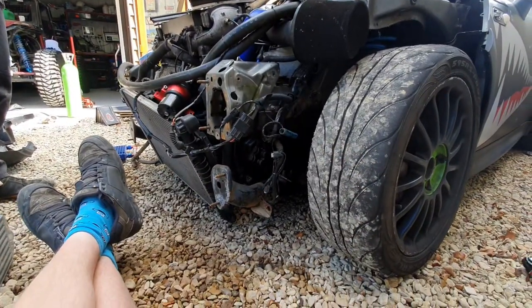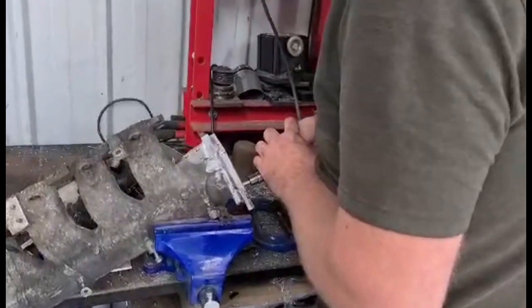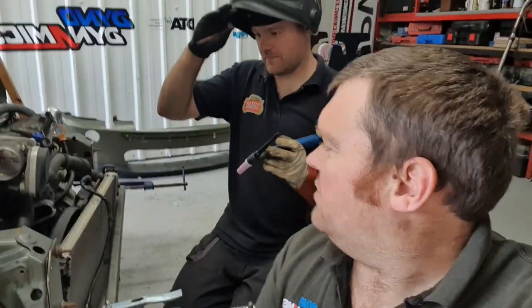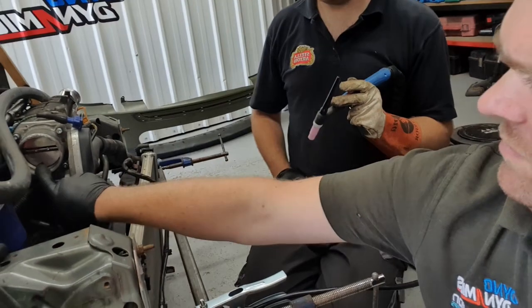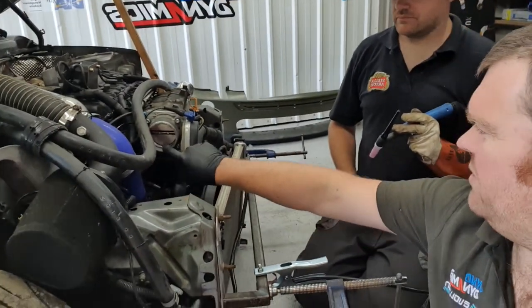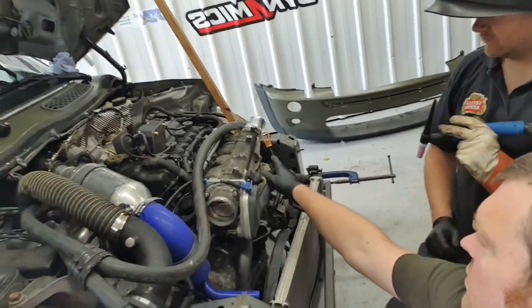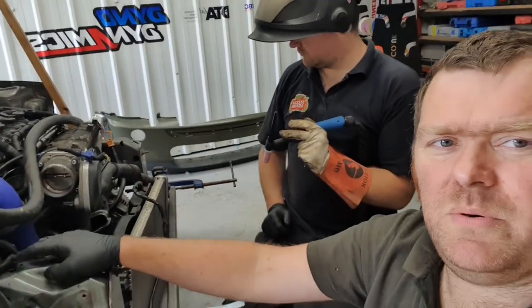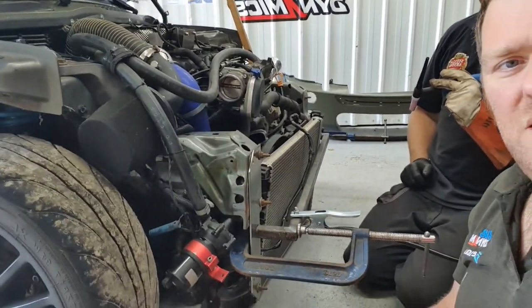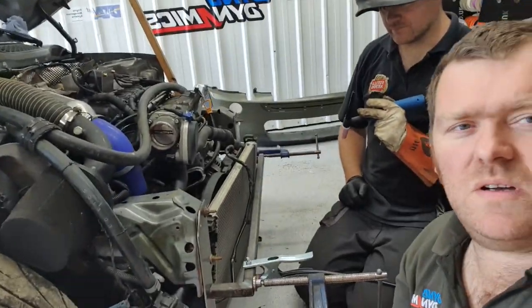Having just lost all this plastic, I think it'll help with our brakes to be honest. We've modified the inlet to simplify things, and we did buy the block of a slightly larger BMW throttle body which we forced in there — they're only about 20 quid. We've modified the horn on the other side. All the rest of it is completely simple now. We've got rid of the plastic piece on the front that holds the radiator, and we're now making this structure which should simplify the front end and allow us to have our front mount intercooler on there.